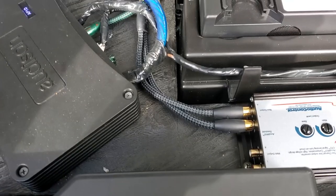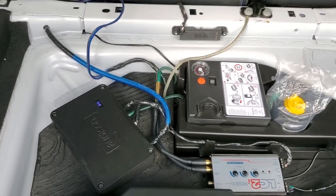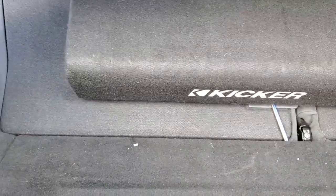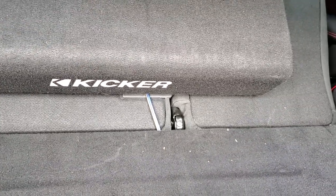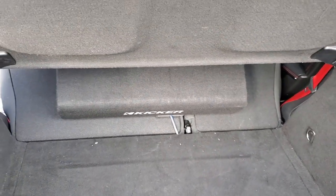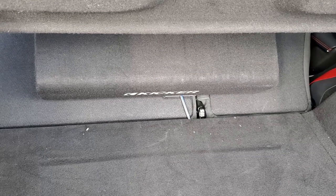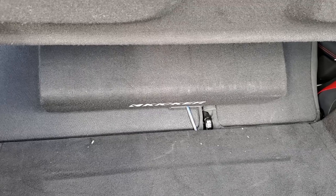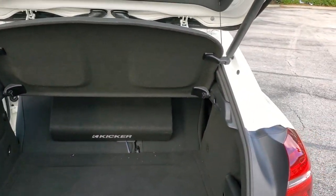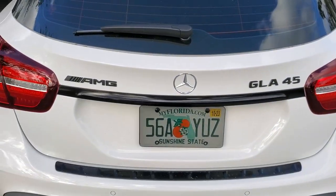That's very simple to do back here. In closing, I didn't have to cut anything up in the trunk — I was able to leave the spare tire area intact. The bass response is phenomenal. It is a lot of bass. A single 12 with about 500 watts RMS with a good clean signal — it's doing really good. I was able to turn the bass down on the system to almost zero on the built-in EQ of the car, and the doors and tweets up there keep up just fine. Those may be an upgrade in the future for a cleaner sound. That's a wrap on the video — hit that like and subscribe button for more builds on the Mercedes as I keep going with the AMG GLA 45.